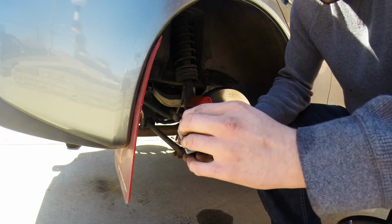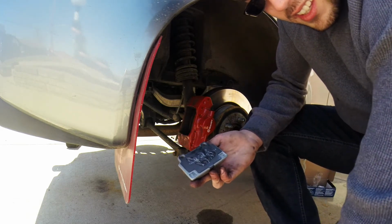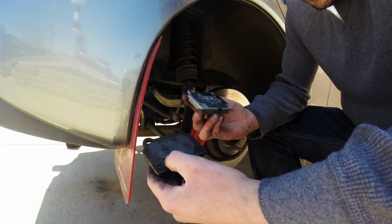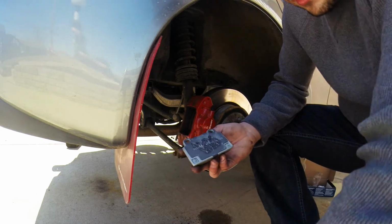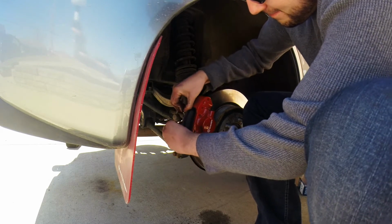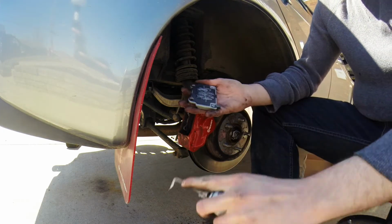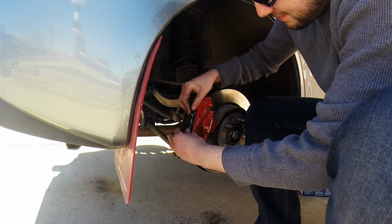No, see the rear of this shim's a little different. Yeah, see that? I don't think I'm going to be able to put the shim back on it for this one. This one we're just going to use the shim that comes with the Wagners. See, it goes in place. This one has that inner shim, so we're just going to set this in there. Just like that.